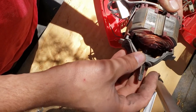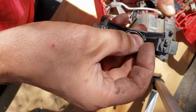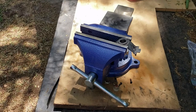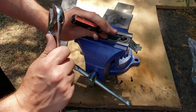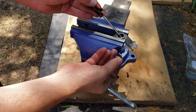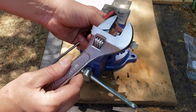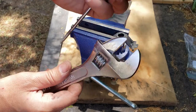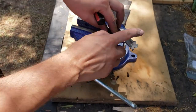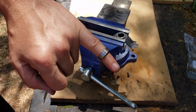I just realized the outer ring of the bearing is still in this housing too, so I need to take that out in order for the new bearing to fit inside. Go one side to the other side evenly — I always try to alternate and hammer opposite sides. I'm not using a hammer; I'm trying to use something that gives a softer blow because I don't want to bend stuff — especially the pieces you need.